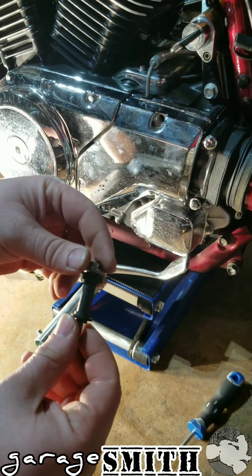Next we're working on the back side of the bike. We'll take the rear suspension off, then work on the back tire and pull the drive shaft out. Start by taking off both bolts for the rear shocks — this side requires a little more finagling. There's a screw you'll have to pull out at the bottom; easier with another person pushing down on it. Then rotate the bottom out of place and the top should pull right out. Then take the torque link loose — it has a bolt on the back side with a cotter pin.